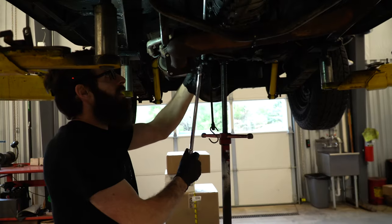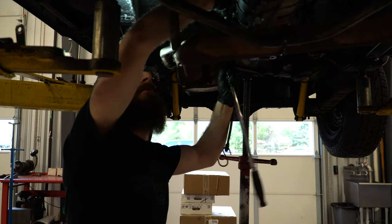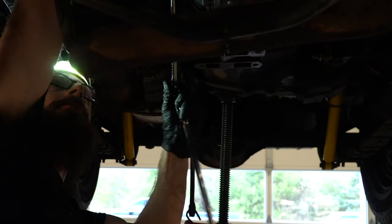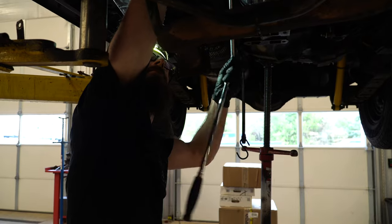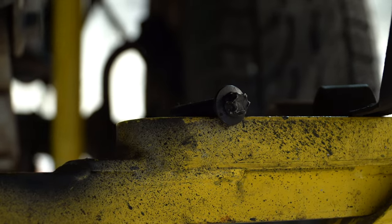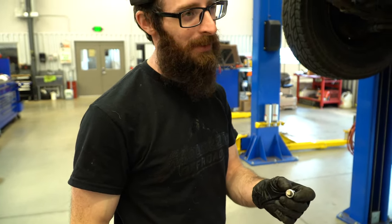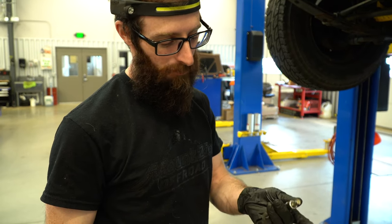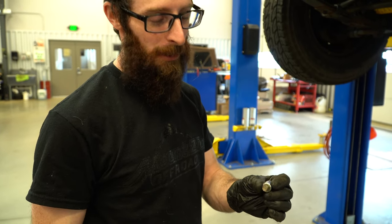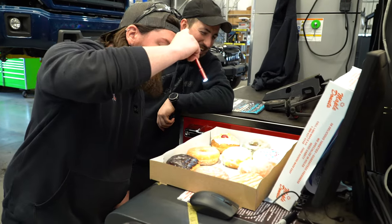Let's get out the lovely E12 bolt on top of the car. One came out all right; the other one had been previously ruined by someone else. The drain and fill plugs on this Peugeot transmission are a 5/16th female bit, kind of like a 3/8th drive or quarter drive but instead it's 5/16th. If you don't have a tool, you can take an expendable 8mm Allen, grind down two sides, and that fits in there all right.